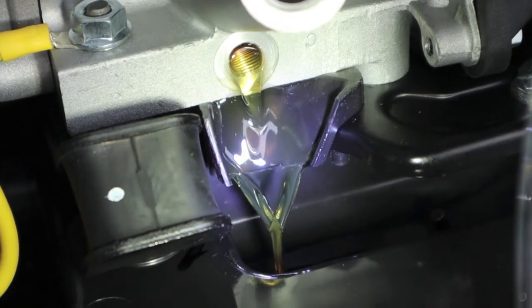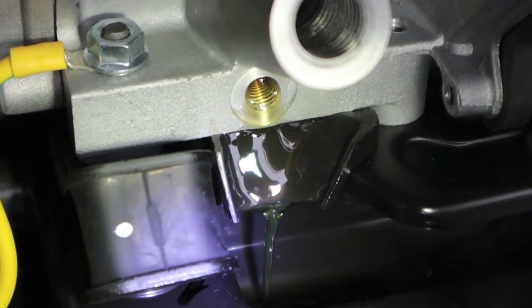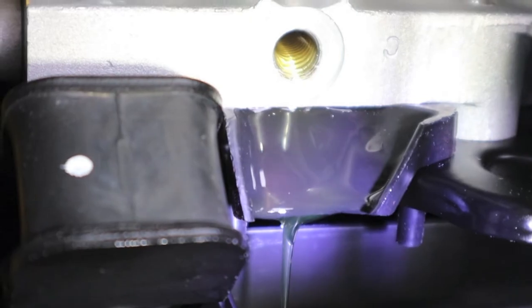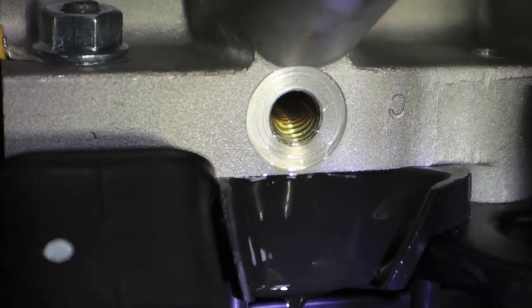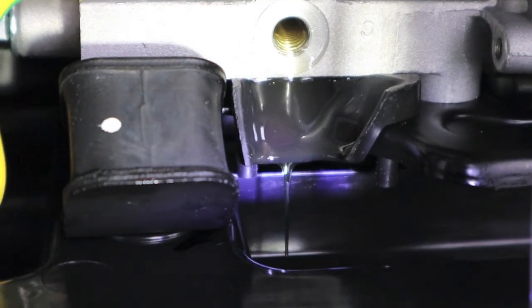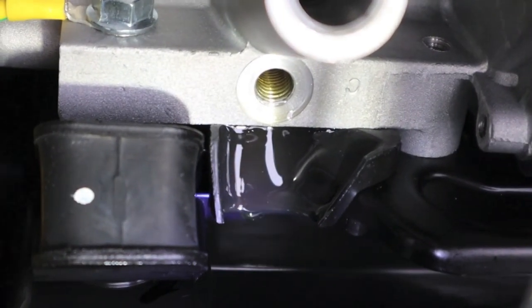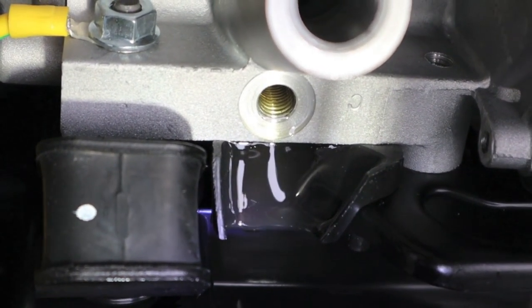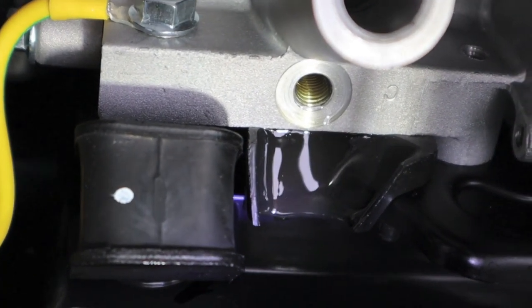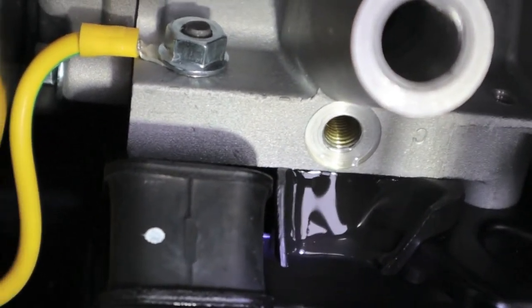It's going to be very hard to get the angle just right where you can see the metal. I can see a few flakes coming out. We're going to filter it out and look at the metal content through a 250x digital microscope drip plate. I can see a real fine metal flake every now and then. I've just seen some there — I'm hoping it shows up for you guys. Oh yeah, we've got metal. Total run time on the engine should be about two and a half hours. It shows two hours, but this hour meter on the total time does not run in tenths or any fractional increments — it's whole hours: one, two, three, and so forth.